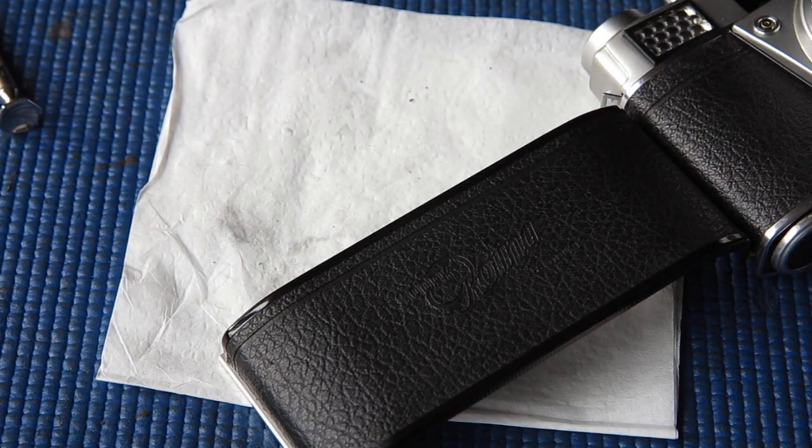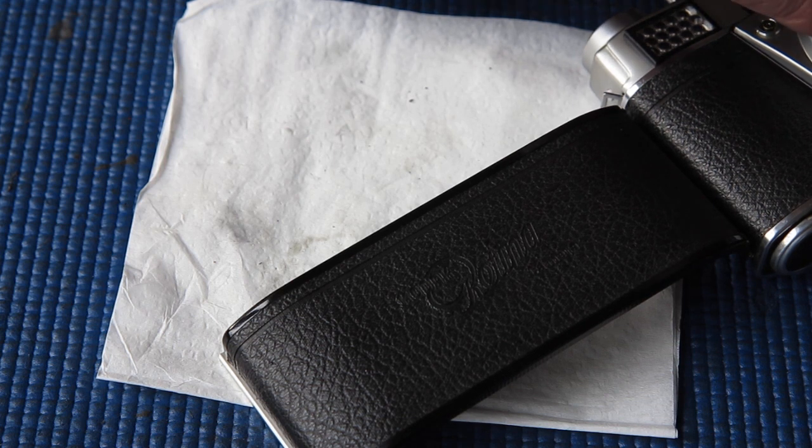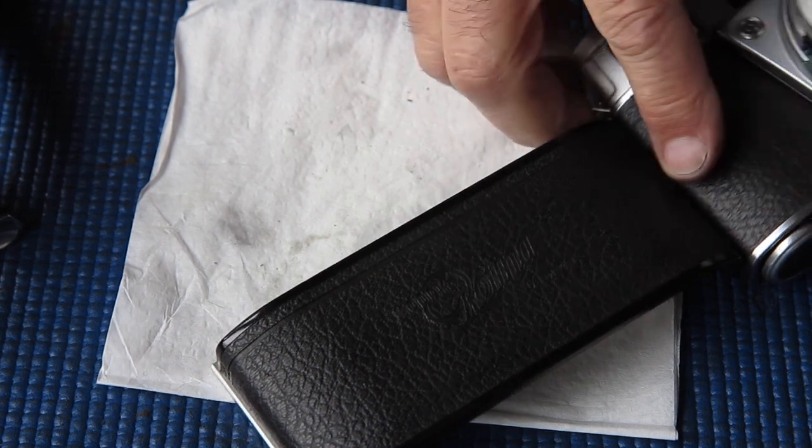Right, now that doesn't quite reach infinity. So back a bit the other way. A viable alternative to using infinity as your focus point is to use a close focus distance that matches one of the positions on your focus scale of the lens. Typically something around 2 meters would be quite good. Closer if you can achieve it.